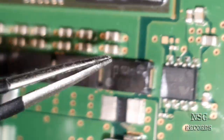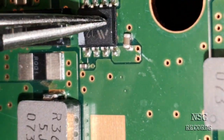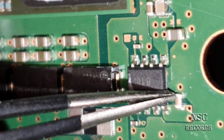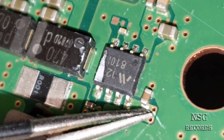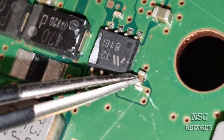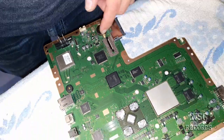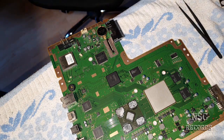Go and hold it just down. You can see this small circle here, see that? Wait, I'm shaking too much, guys, because I'm watching myself on the motherboard. This small circle here has the same contact as this capacitor here on this side. So just to be on the safe side, you can solder this one to here because it's the same contact. And this circle here is the same contact to here. This circle and this circle, they are together on this line here, okay? So this is just no problem for me. I'm going to do that right now because otherwise I cannot keep recording it. And then we're going to go for the CPU heat spreader. So let's turn my magic machine on, which is my solder iron.